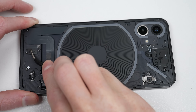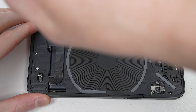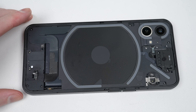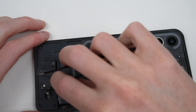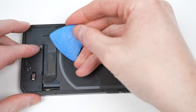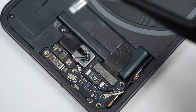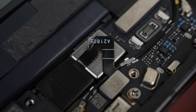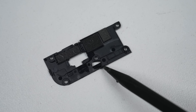Next, there was another aesthetic detail to remove before I could unfasten the Torx screws securing this piece of plastic. Again, I was facing a problem — this piece of plastic just wouldn't come out. I could see that it was clipped in at the front, but I couldn't get the clip to budge. As it turns out, hiding a screw under one layer wasn't enough, so they also put a liquid indication sticker on top to hide it further. Once the screw was out, it still took some force to remove. Unfortunately, in doing so, I damaged the fingerprint reader cable — the first casualty in any of my teardown videos. However, despite the small tear in the cable, the fingerprint reader miraculously still works, so I obviously didn't damage any of the important traces in the wire.